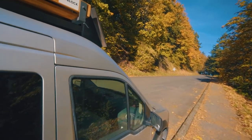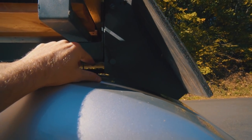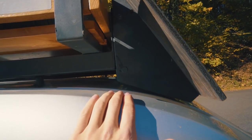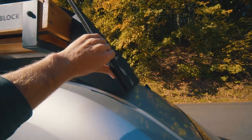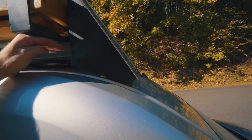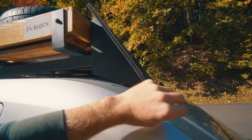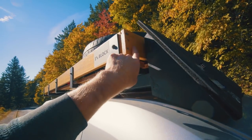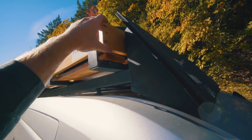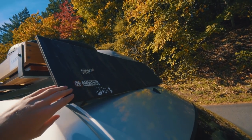Toward the front I didn't want to extend too far. I don't know all that much about how wind noise works, but I didn't originally plan to have an air dam and I didn't want the 2x2 square tube to create a huge cavity for wind to get caught in — I thought it would make a lot of noise. It did still make a lot of noise, and I think it was mainly because of the 1x4 on the front. So instead of taking that off, I just built the air dam, and it does work pretty well.